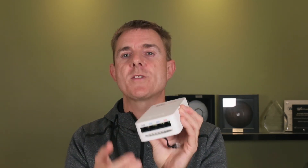Remember that first port there won't be used — you have three usable ports here that you can use as well. Maybe that's your smart TV, maybe it's a printer or a computer — all of those types of things. So a really versatile access point. The one port on the underside is to provide the power if you're doing power over Ethernet.